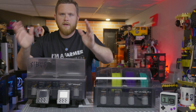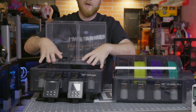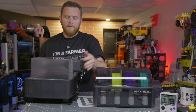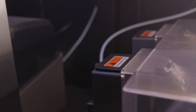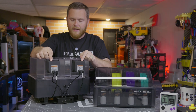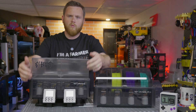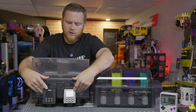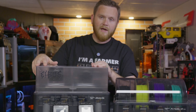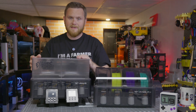You get two separate climate zones that are fully controllable. Not only do these things heat and give you two separate chambers in the lid, they also have acrylic pieces that separate the inside of the AMS into two separate units as well. There's also mechanical ventilation on the back — literally motors that lift this up, the fans pull in fresh air, and exhaust out old hot air, which means you're actually getting rid of the moisture in these chambers.